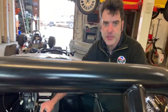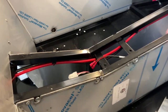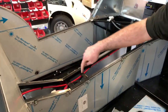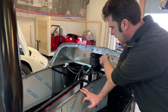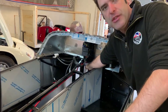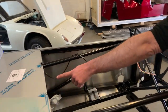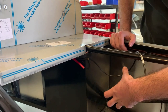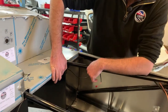The fuel lines — we have two nylon fuel lines: red and black. Red is normally for the feed, black for the return. On the Gen 2, these go through the brackets on the chassis that have grommets in, so they feed all the way through. We then just put a couple of clips in to help secure them, just to be extra safe. They terminate just at the front under the scuttle. They terminate there and then we connect on for the swirl pot, which we'll look at later. Make sure you put the metal ends in so you don't crush the pipe when the connections go on.